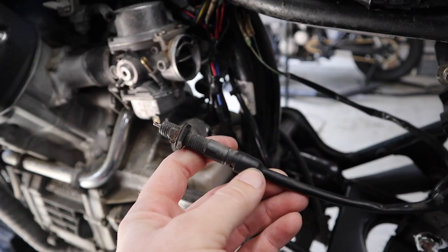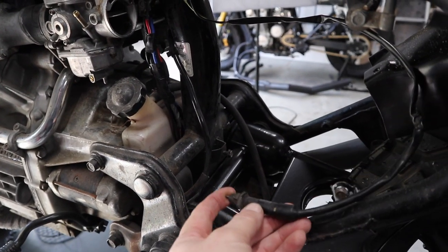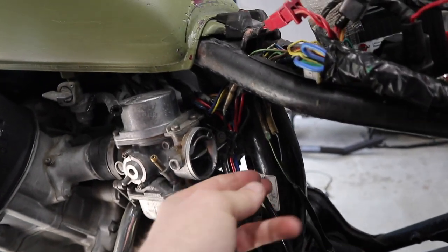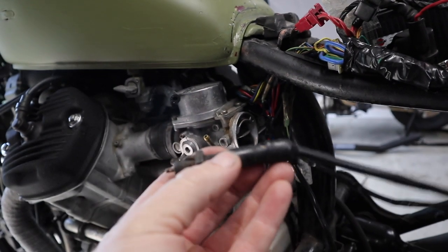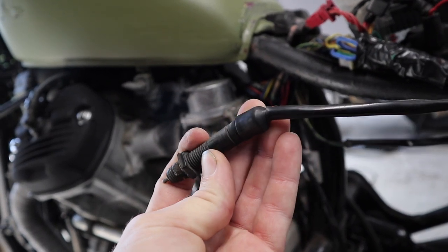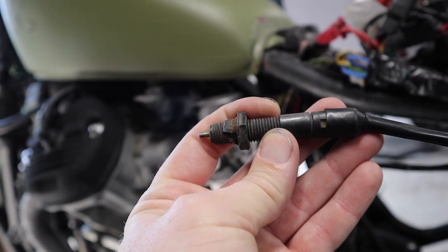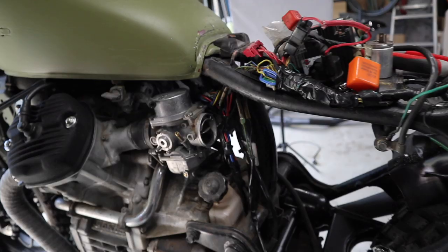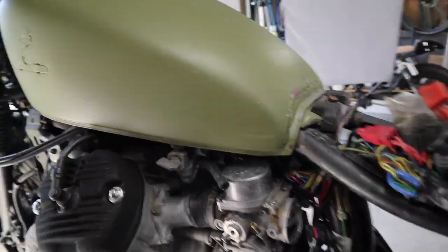The other thing is the brake. So this is the rear brake signal which will obviously turn the brake light on — it sits down here and it's not working. I've problem-solved that by disconnecting it and then touching the wires together, which turns the brake light on. So I had a look online — it's like $1.70 or something. I don't know if these things are repairable; I don't even know if you can pull them apart. But at least I know that the tail light wiring is working — it's just that switch that needs to be fixed.